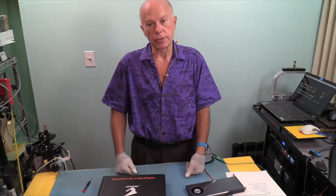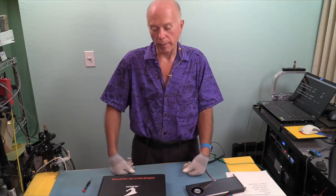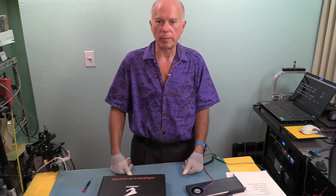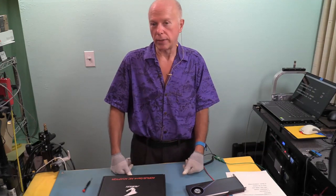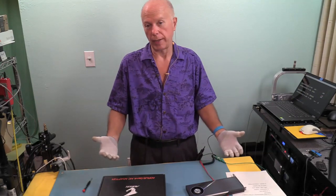You gotta know your resources. I remember when we used to deal with IRQs, and that was a big deal. I remember when we dealt with UARTs. So that's kind of where we're at right now with PCI Express resources. It's gonna get better and get smarter. I already see it happening with PCI Express 4. It's supposed to be automatic. We're gonna find out when we get into the BIOS.